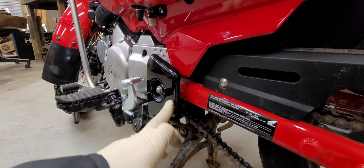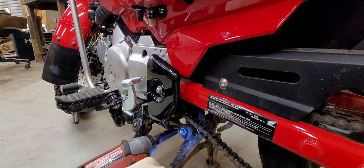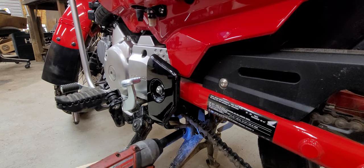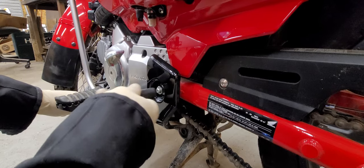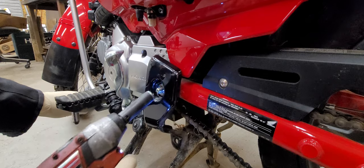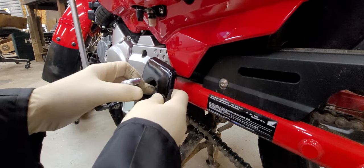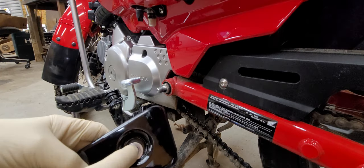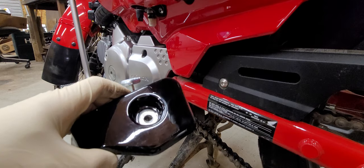I don't know if it's 100% necessary, but this is a heel guard — let's go ahead and get it out of the way. There's a 14 and a 12, I believe — the 12's on the bottom. We're just going to use a little 12-millimeter socket here. Get that out of the way. We'll shift the shifter down and get that off. There's going to be a washer in there, so make sure you don't lose it — it stays in there. That's just a little heel guard. Nice black powder coat on it. Good job, Honda.